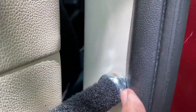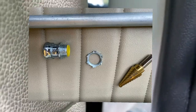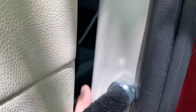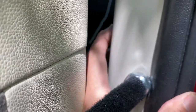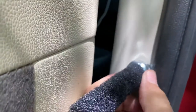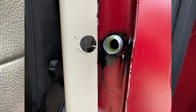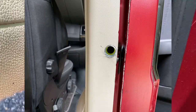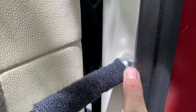This is a conduit end cap — it goes right into the B pillar. I pulled off the plastic, saw that I had easy access to get inside the B pillar; there's a big opening back there. I drilled a hole, primed it up for rust prevention, put this end cap in, and twisted the nut on the other end of the end cap.